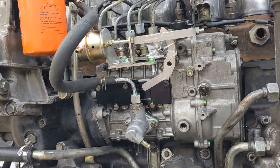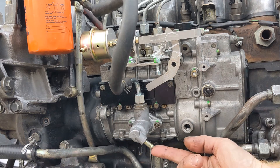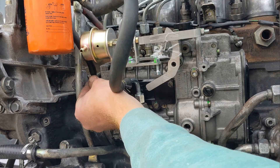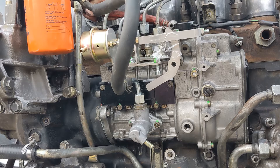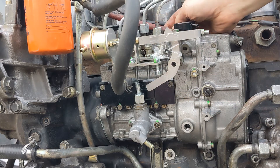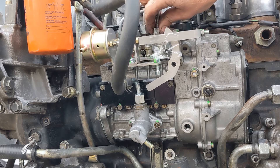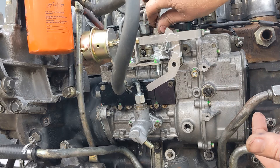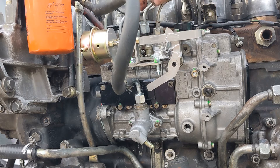The plug goes on the oil feed port and the fuel inlet on the front takes a hose from your tank — fuel comes from the tank, goes into your fuel filter, gets cleaned, comes out and connects to the front of the pump. The return line in the back uses the same bolt and acts as a pressurized valve. Finger-tighten all the lines, then crank the engine to let the air out. When you see diesel coming out of the hard lines at the injectors, go ahead and tighten them down with your 17mm.